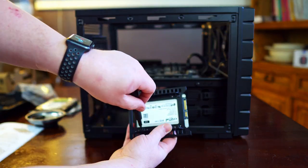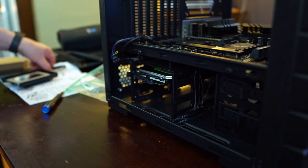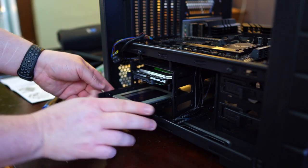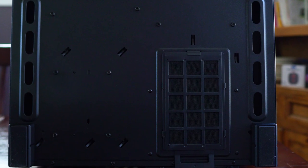This is definitely disappointing. One would think toolless installation and removal would be an advantageous feature with the presence of hot swap bays. Finally, should you not need them, you can remove all three drive cages as they are held in by Phillips head screws. This is great as it will mean more room for cables or, should you water cool, a pump and res. All three cages are held by screws that are attached at the bottom of the case.